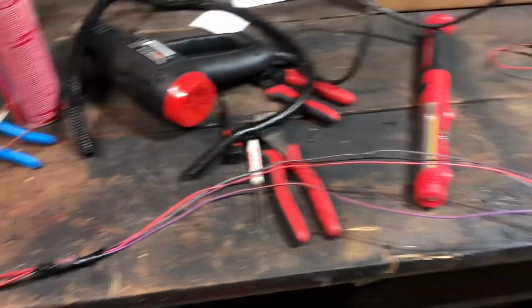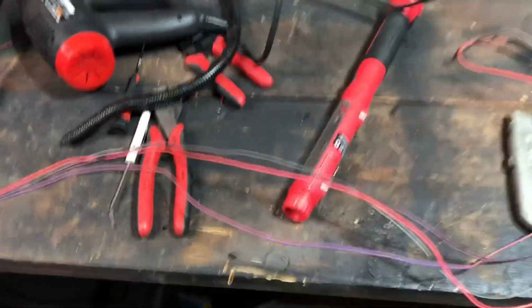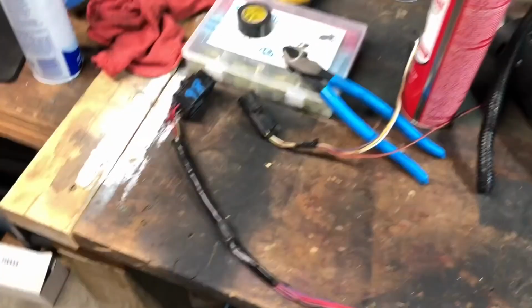and then go down here and take the two O2s that are on this harness, cut them free. I'm saving that in case I need some wire for the engine harness. I'm not sure yet. But yeah, I'm going to just tape this all up. I'll put a couple clips in it so I can plug it back in. And then that'll be the transmission harness done, so I'll have backup lights and a working speedometer, I hope. So there's that.